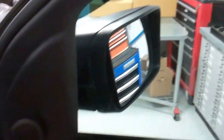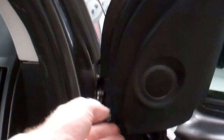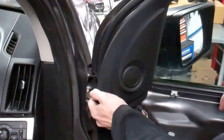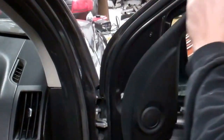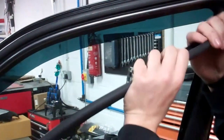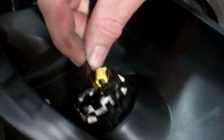Now we've got to run the wire through the mirror, so we need to expose where the wires come through. This connector here - pull and twist off. You could leave it hanging but it's easy just to twist off. This one has little push-pins just for the tweeter. To remount it, hook it on the inside and click it into the rubber trim, making sure to tuck it in behind between the metal and the rubber.